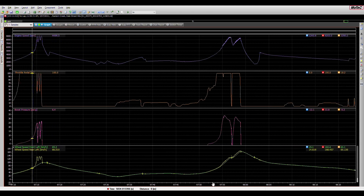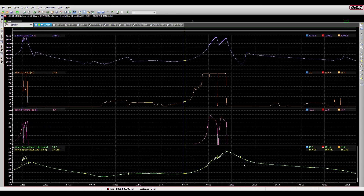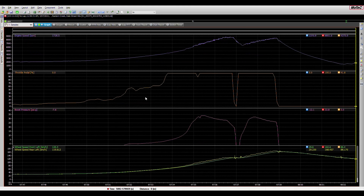We then performed our second hit with traction control turned on. Rolling onto the throttle, I go to 100% throttle. The car's at about 4,500 RPM, 4.5 pounds of boost. As we speed up and the car starts to make boost, we get to around 12 pounds at 100% throttle, about 5,300 RPM. You'll start to see the rear tire break away from the front — about 81 kilometres an hour on the rear wheels versus 76 on the front. As that happens, our system takes over. We start to reduce ignition timing and start to control the boost, which you can see rolling over rather than coming up like a sharp line. Traction is maintained at around our 5% aim.